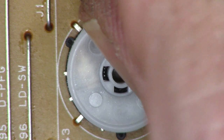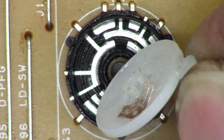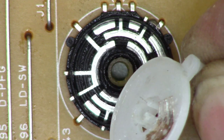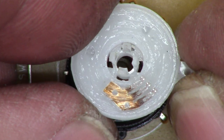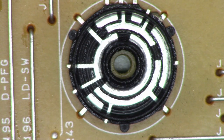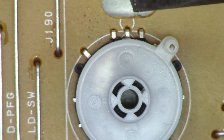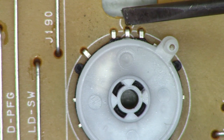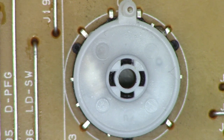Because I thought this was just going to be a regular service — a VCR cleaning, a DVD cleaning, a mode select switch cleaning — I didn't show the actual cleaning of the mode select switch. This is what it should look like inside after you've cleaned it and applied the dielectric grease: it should be super shiny, basically spotless, and the wipers should be perfectly clean — shined up with a stainless steel toothbrush. Make sure the circle lines up when you reassemble the unit.